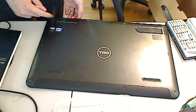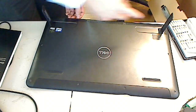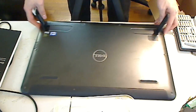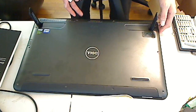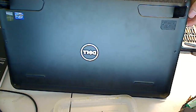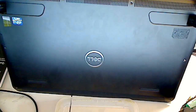One thing I noticed is that this thing pops open on its own in a specific way. In order to take the back cover off, you need to put these two feet into the vertical rotation orientation. See those two little latches? They still have to be open, otherwise it won't come off. So once you do that, you open from the bottom up, and just be careful because there might be wires tangling in there. It looks like there's no wire attached to the back cover.